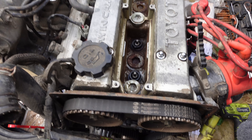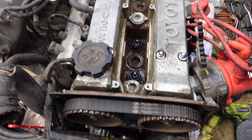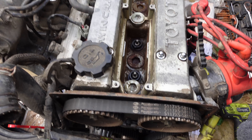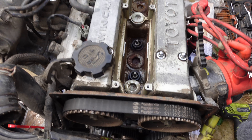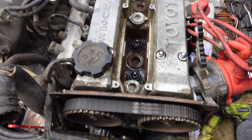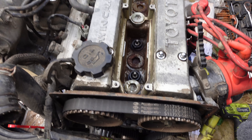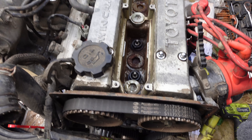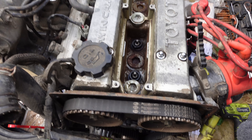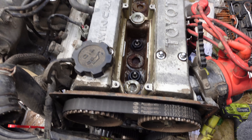It's starting to look like an engine again. That one's now not looking like an engine - it's been completely taken apart and that's fine. Now I need to take a look at this fuel rail because I just need to double check that they're near enough the same, which I think they are. There seems to be like two regulators on it though. That's a regulator there. There doesn't seem to be a regulator on this one, actually. Fuel pressure regulator.